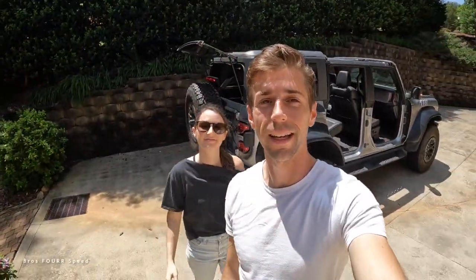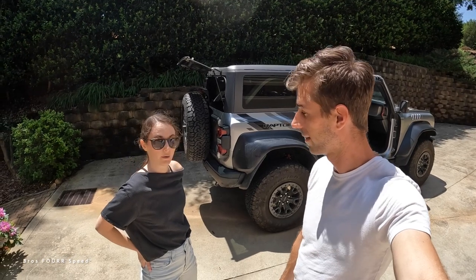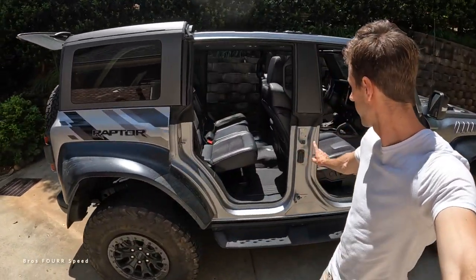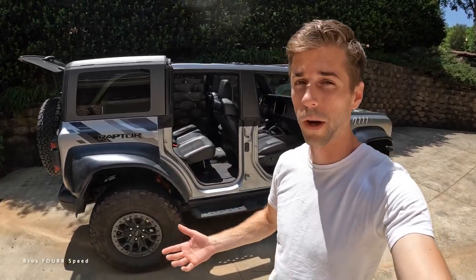So there you have it — taking the roof and doors off the all-new Ford Bronco Raptor. Really not a hard process. The rear hard top is a bit heavy, so once it's off you'll probably leave it off rather than putting it on and off every day. Comparing to the Jeep Wrangler: the door posts on the Bronco are not as large, so you have to keep the bolts fully in — you can't just leave them loose with the hinge. Also, the bolts are exposed on the exterior of the Bronco, whereas on the Wrangler they're hidden — a minor difference.